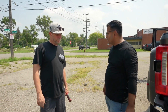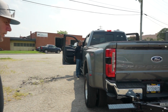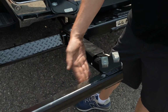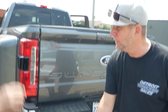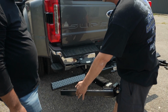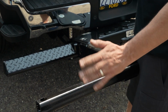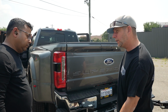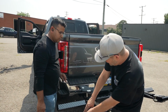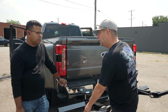Mike, what about the sleeves? Why do we need the sleeves? You need the sleeve, hit the jaws, close all the way in the jaw. Let me show you something. The reason why people need sleeves is because they have an L arm that's fixed. It's welded. It doesn't move. So they need something to shorten the distance from here to here. You've got a spring-loaded L arm. You could push that in right here, strap it, and it can lift. It's structural. In this position, it doesn't matter. You have adjustability from here to here for whatever your load dictates for it to grab. You follow me? Yes. And you can strap it in this position over the rotor, over the control arm, over whatever you need to do and lift up.